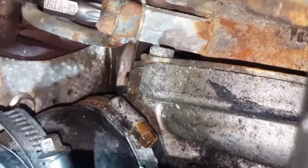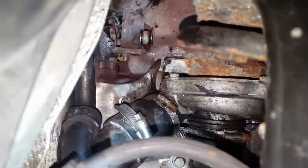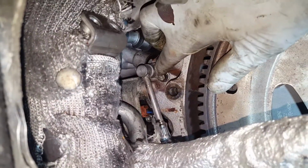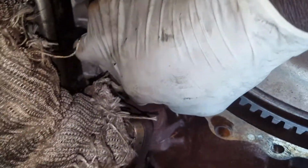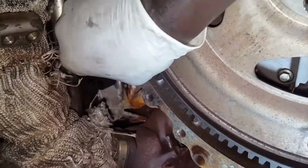Yeah, that's 50 torque, and then I will use a spanner to open it up. Now the feed pipe is out of the way, but I'm going to take the feed pipe out completely. So if you come this side, I'm going to take that screw out, and then this feed pipe will come out completely, because I'm trying to get to the screws for the turbo, the two of them, and the pipe is kind of in the way. So I'm going to take the pipe off completely.